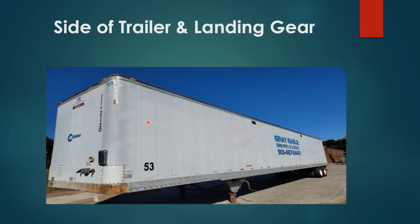Side of trailer and landing gear inspection. You have marker lights top and bottom. Properly secured, no damages. Side of trailer, properly secured, no damages. DOT reflectors, properly secured, no damages, more than 50% visibility. Landing gear, release arm in lock position, and foot pad, all properly secured, no damages. Cross members, properly secured, no damages, and frame underneath the trailer are properly secured, no damages.